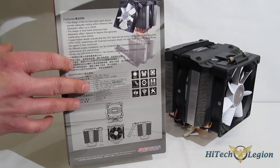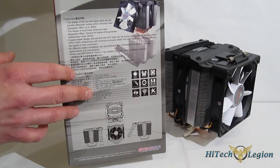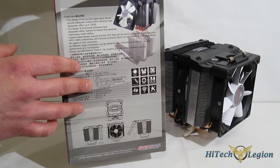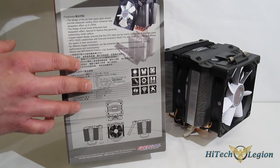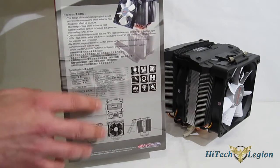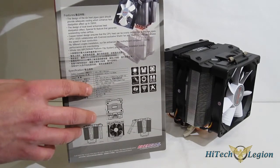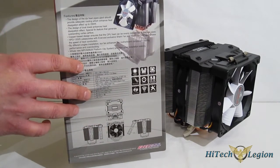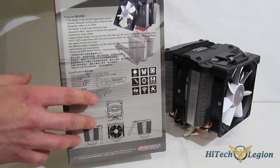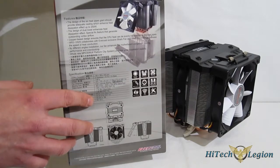It uses two different fans. The Silent Shark fan is a fixed RPM fan at 1400 RPM, while the Silent fan is PWM at 800 to 2200 RPM. The Silent Shark comes in at 26 dB while the Silent fan comes in at only 16 dB. The Silent fan is capable of 66 CFM, while the Silent Shark up front is capable of 60 CFM.